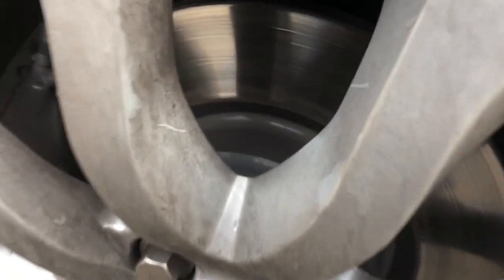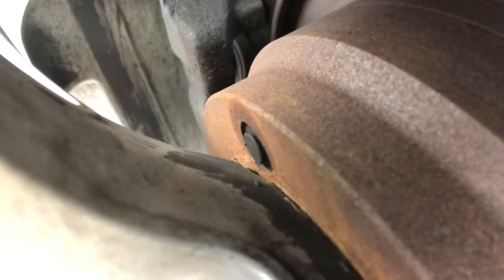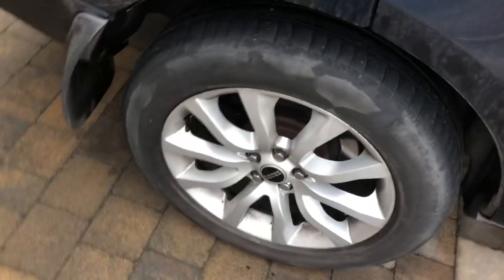When it comes to the brakes, they're very important — especially important on a big car. Stopping power is really important. So check your brakes. Have a look at the discs. Are the discs in good condition? How new are they? Is there much of a lip at the edge? When we talk about a lip, that's how much it's worn on this bit compared to the edge. This is a brand new disc, so obviously there's no real wear there. Get right in and have a look at how much meat is on the brake pads as well. Go around all of them, check them all. Check if there's uneven wear — it's important.